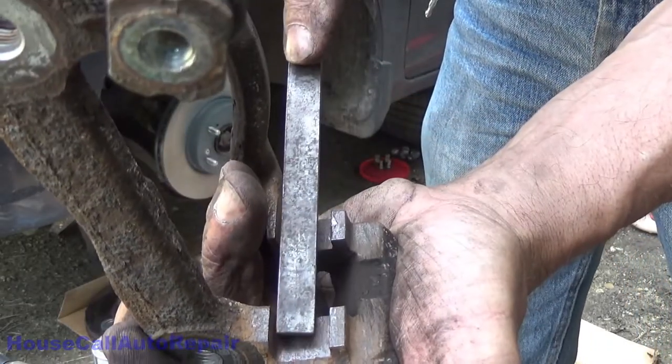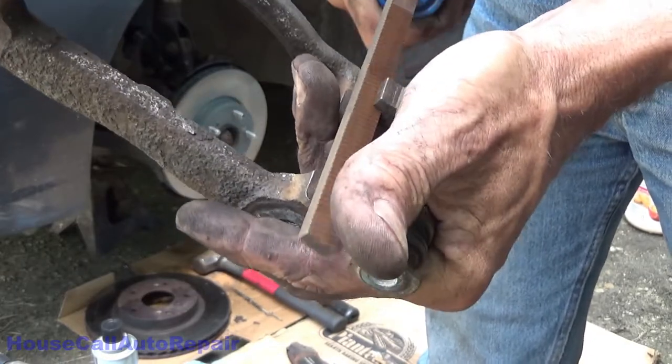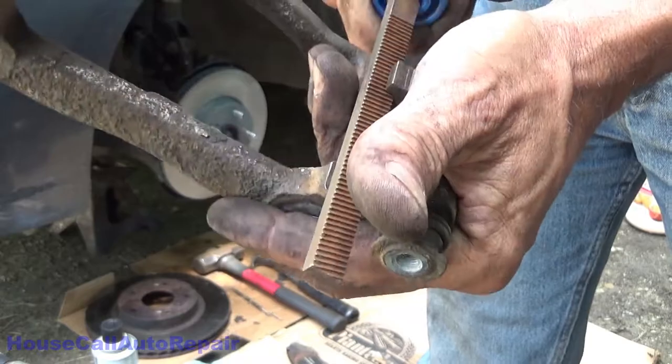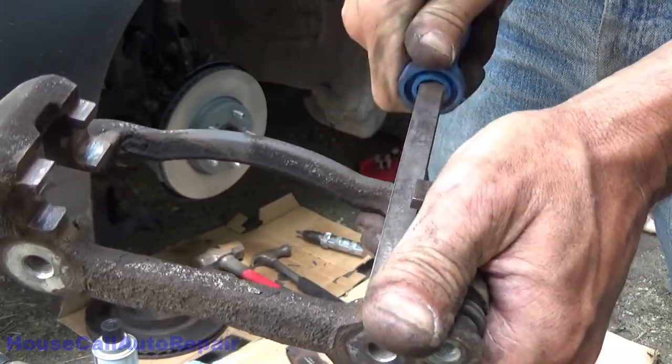See the spots that are turning brown, that's where the rust is actually coming off. There's other ways that you can do this too. There's wheels that you can use. If they're really, really abrasive, be very careful because you can take metal down very quickly without realizing it.